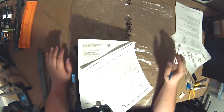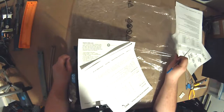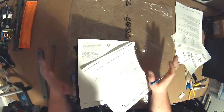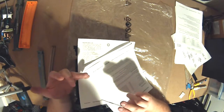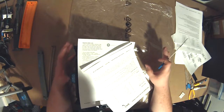I recommend that if you're doing this stuff professionally, or even if you're not, get yourself some white or black kitchen garbage bags, the little ones. So when you take a cartridge out, you put it in the bag, that way it doesn't spill, doesn't make a mess, and it's protected from the light. Because the manufacturer will ship it in a bag for a reason: to protect it, and also to protect you from it.